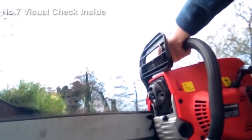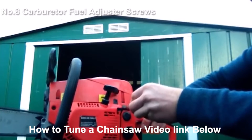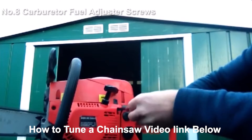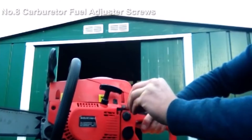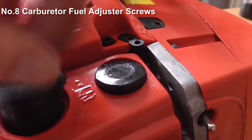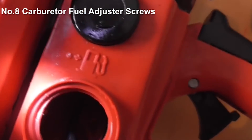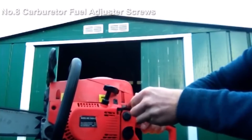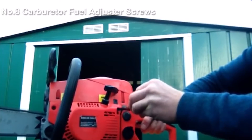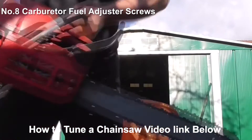If we've checked all that and find all is great, brilliant. But if not, the next thing I would check is the carburetor adjustment screws. There are several reasons why a carburetor would need an adjustment — it can be as simple as someone else having borrowed the machine and adjusted it wrongly. Also, when we use different fuels and different mixes, that can sometimes have an effect. We may just need to tweak the engine slightly, particularly if fuel was going slightly stale so that combustibility wasn't quite so good. Making adjustments in those situations can mean that when we put decent fuel in next time, it won't run quite so well until the carburetor has been adjusted for the new fuel. This issue can have a big impact on starting problems with these types of machines.